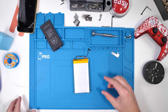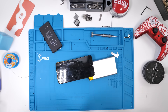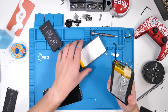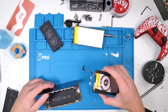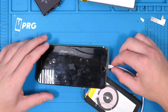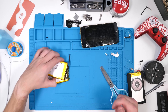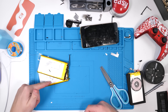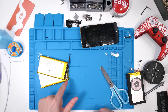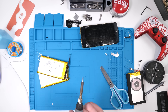I already soldered it onto a new BMS board. Let's see if the second attempt works. Hopefully it does. So I did the same thing with the broken battery, because for whatever reason this one doesn't want to work. So we're going to see if this one works. So we just have the Apple logo running continuously, which means it doesn't even recognize that there's a battery plugged in. So it's quite possible that both of these batteries are messed up. I'm not giving up yet — I'm going to try and desolder the wire from the battery so that I don't have to solder the wire to the BMS board again.